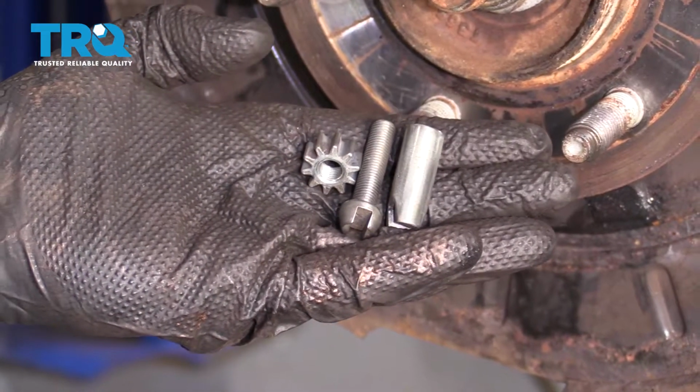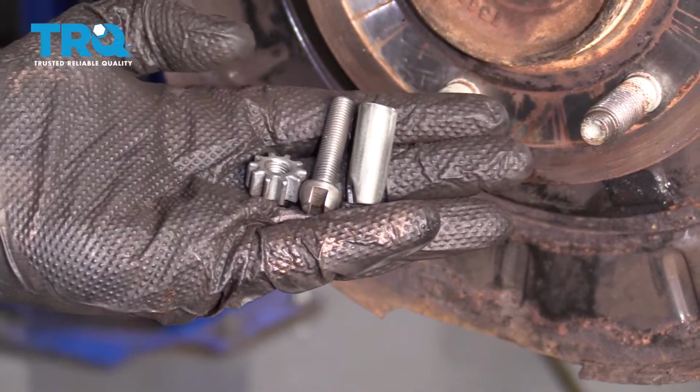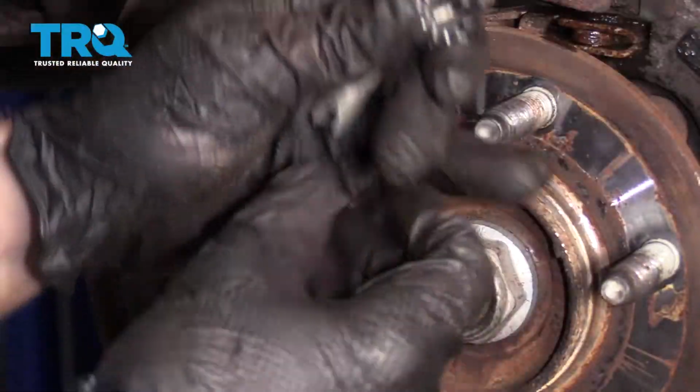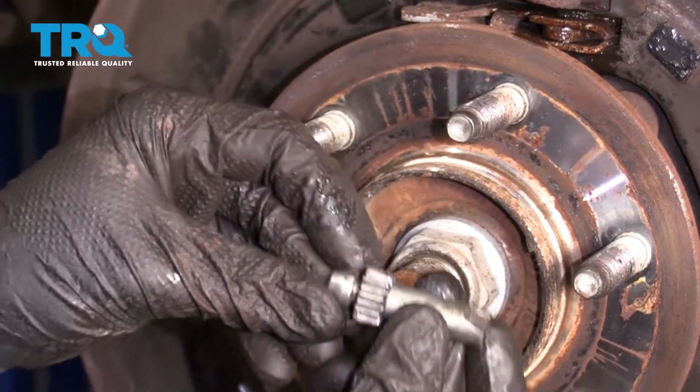The next thing that we're going to want to do is disassemble our adjuster, clean it up, all the threads, and then we're going to add a tiny bit of lubricant to make sure that it keeps moisture away from it. Tiny bit more grease on this lower aspect again, and then of course we'll get the backside on there. Work in that lubricant, we'll set this aside.